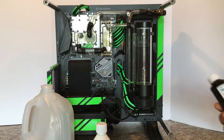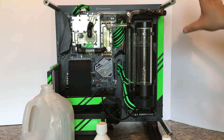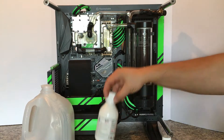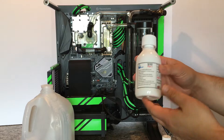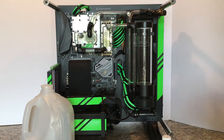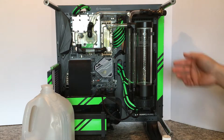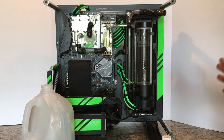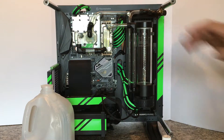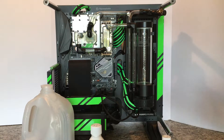Part two is pretty much like a soap or some sort of detergent that cleans out the entire loop. Part one is an acid which you use primarily inside of the radiator to decontaminate it. The footage from the previous video was for my other build. This is my Rath build, which you'll see pictures of filled with a green coolant on the website, ModScience.net again.